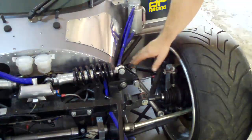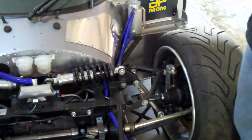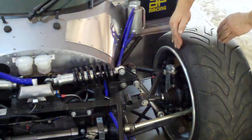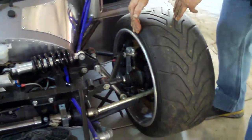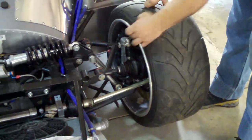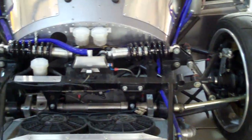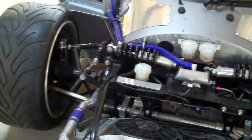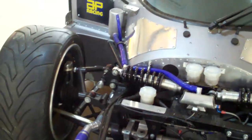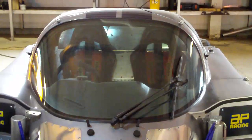The front suspension has been completely reworked. On a normal Ultima they run Ford Cortina uprights — geometry and technology from the 70s where they ran 175 or 185/70/13 tyres, tiny little tyres with a bigger sidewall. Now we're on 18-inch rims, very low profile with a different offset on the wheel. When we first drove the car it just pulled all over the place on white lines — you couldn't steer it. So we've ended up redesigning all the front steering geometry and all the uprights, put some huge brake calipers on it, and got all the kingpin inclination angles and Ackerman angles correct. Now you can drive it with one hand, no problem.